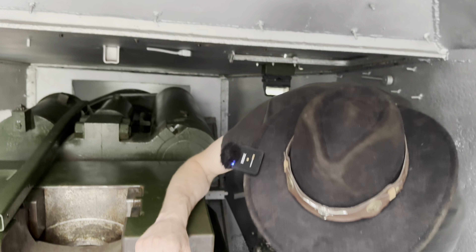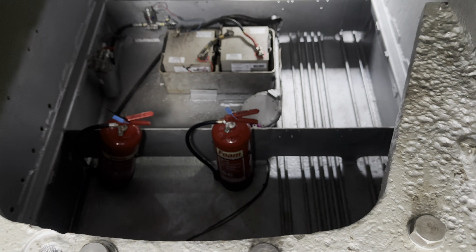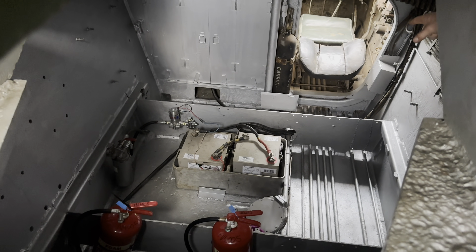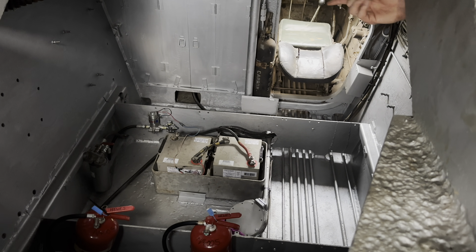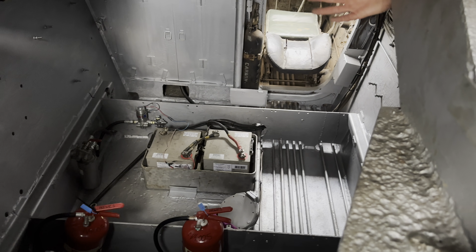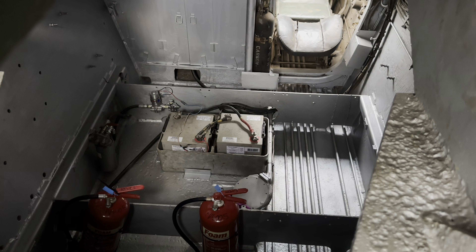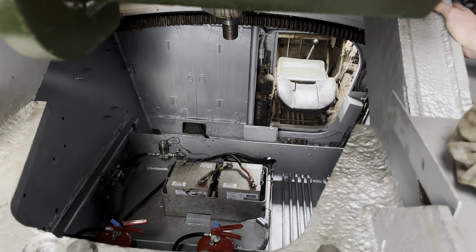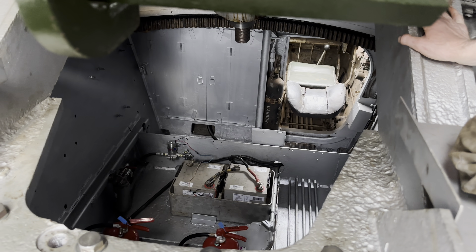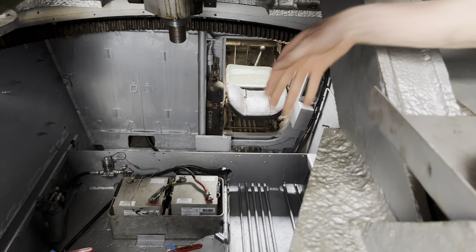Down there we have fitted the fuel components — the fuel tank is actually in between those two little doors up front, and all the fuel parts have been made out of hydraulic line. We put a screw-on fuel filter just for quickness — it's cheaper and yes, you can get the filter off. We're running a Holley fuel pump with a regulator, recommended by a good friend of mine, Adrian Clayton, who is very clever with Centurions. It runs amazing off that pump — it makes such a difference.